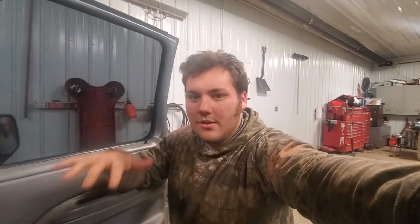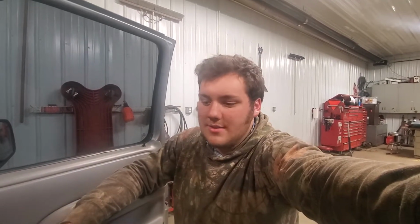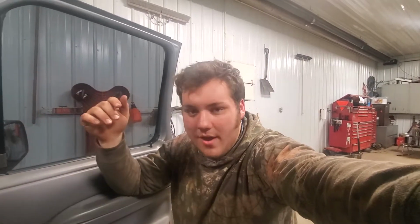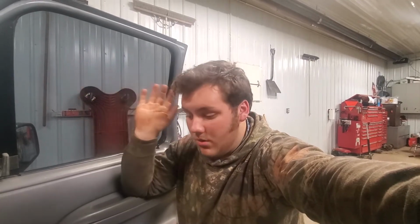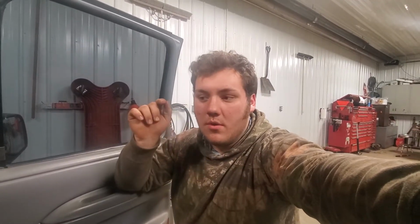So I tried to lift that plate up and slide it over the side of the tranny. The trans won't go far enough down with this, and I've heard of other guys just taking this plate off. It really wasn't that hard, so I'm glad we did it that way and didn't have to pull the tranny or whatever. So anyway, the people that typically watch my YouTube channel, I haven't told you this yet.